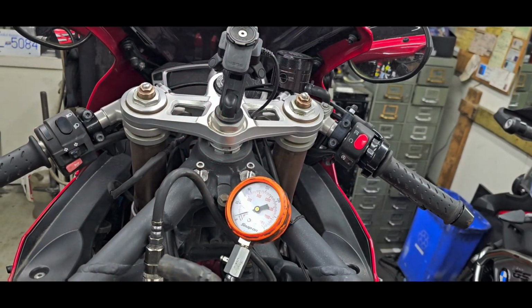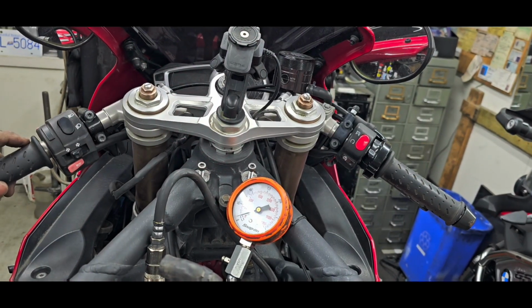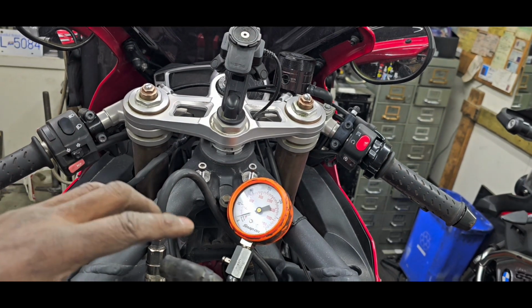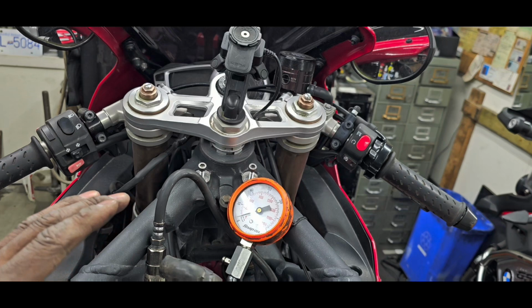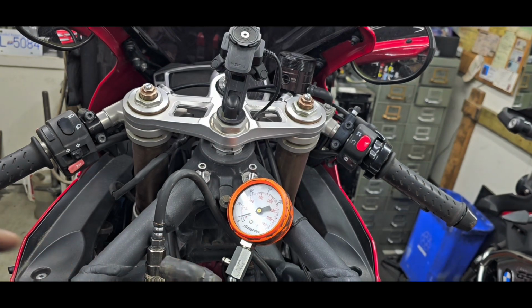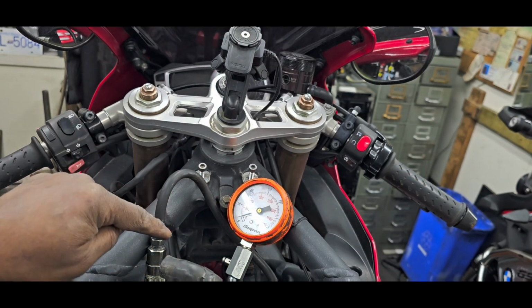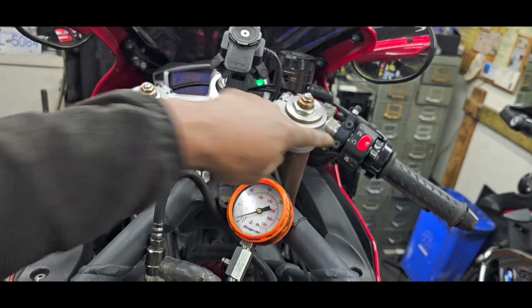Okay, my friend, and here is why. We have a considerable setback here. I have provided your bike everything it thinks it needs to try to start. So I'm going to show you our compression test live. So there's the test gauge. We're in cylinder 1. We're going to hit the key. The kill switch is already in run.